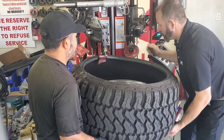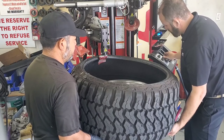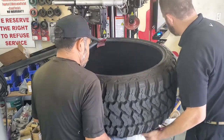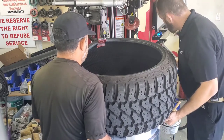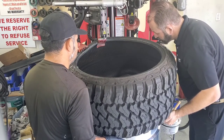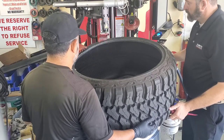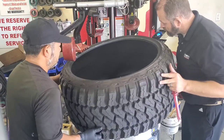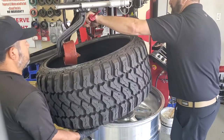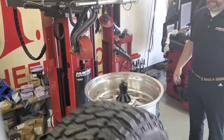I'm just checking the TPMS sensor and making sure it's in a safe spot — when I bring that lower roller up, I don't want it to contact anything. So I'm going to get that upper roller up out of my way a little further. Then you'll notice I rotate the wheel just a hair as I pull up, just to make sure it's all the way up in that drop center. Then I'm going to bring that lower roller, looking through the top of the tire so I can see it. As it comes up and peaks out the top of the wheel, I'm going to indent it just above the edge of the wheel. Once it's in a good position, I'll release the mount head so it has a little more freedom and get that up out of the way, then continue dismounting that bottom bead. That bead roller takes that off very easily. Miguel showed me this little trick — he rolls that tire up around those bead presses and tilts it off without hitting any of the tools. Pretty neat procedure.